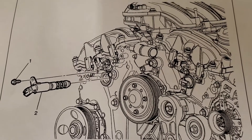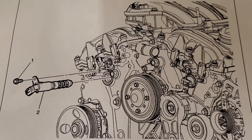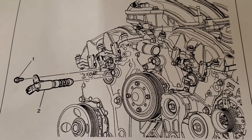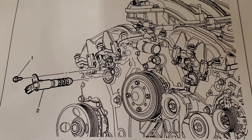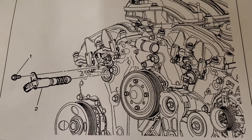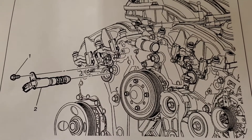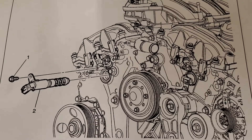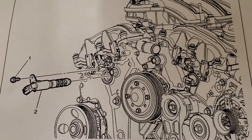What we have here is a 2014 Chevrolet Impala limited police package vehicle. We have the 3.6 liter engine and we got a P0014 engine code. That code is for exhaust camshaft position system performance bank one. It's a fairly common code for this vehicle and there's a fairly common repair that I do to fix it, so I'll show you how you do that.